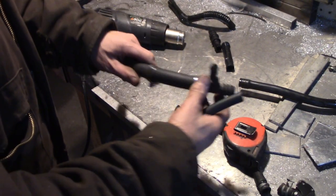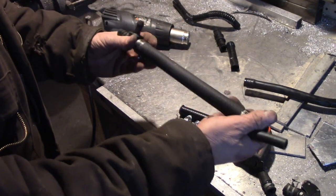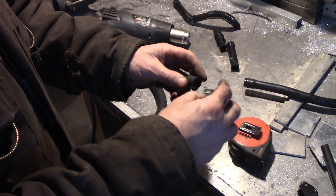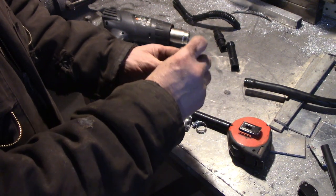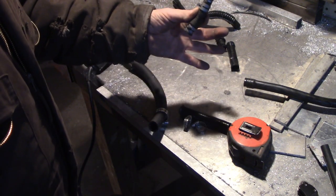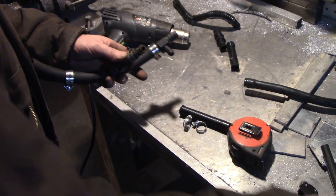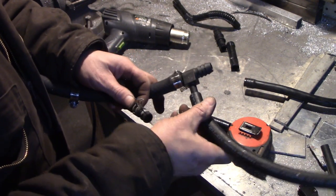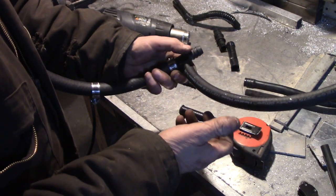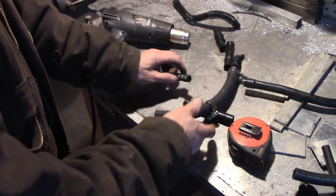So this goes to the heater core on this end and we'll clamp it on that hose inside, and this goes to the T. That came down - these are the OEM clamps, I think it's 5/16 whatever it was. I just mangled them since I wasn't going to reuse them. When I was at Napa getting heater hose I asked for a little section, which was the right size because I was standing there with the parts. This will fit on there and we can clamp that. However, on the car where this T is, going up it's only a 5/16 metal nipple, so I was looking at this hose wondering how does that work.